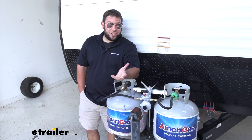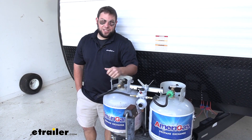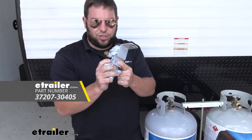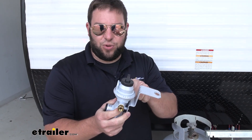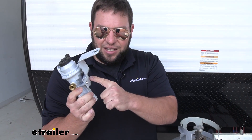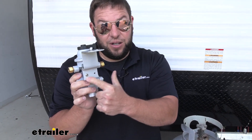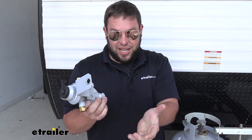It's pretty straightforward. That's how the regulator works and how you would replace it. But how does it install? It was pretty easy, so let's check out how we did it. This is what it's going to look like when you get it. We added a bracket to our regulator that JR Products also offers on our website, because the old bracket wouldn't work with our new regulator — it had four screws and the screw spacings didn't match up. This one's an inch apart, so make sure the bracket matches so you can attach it.